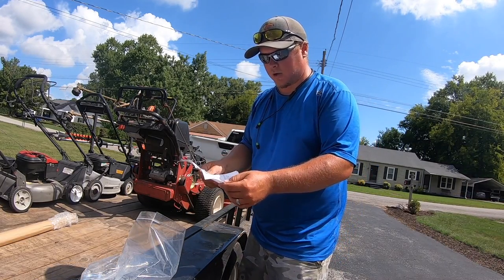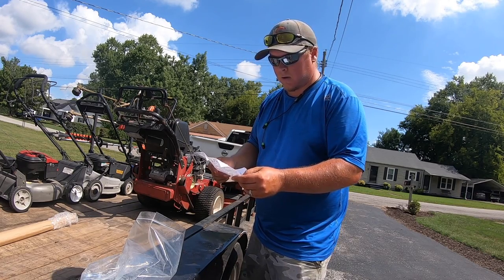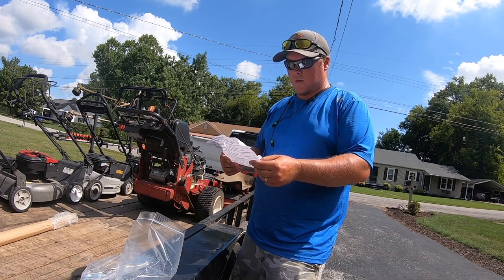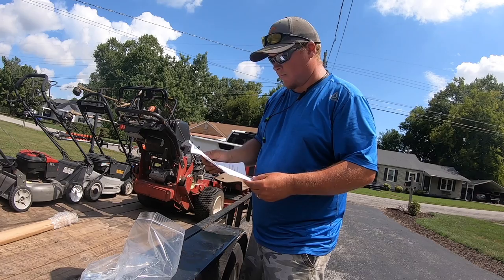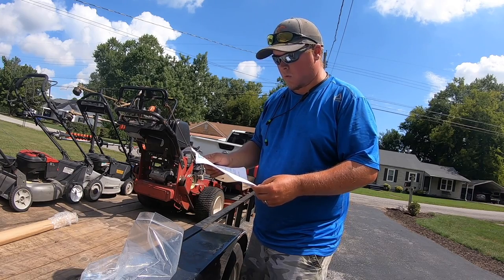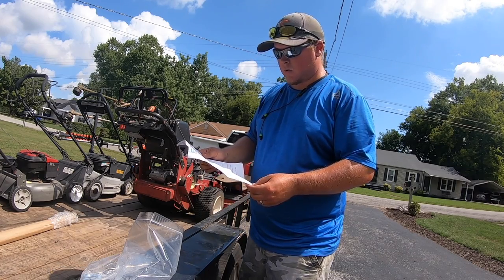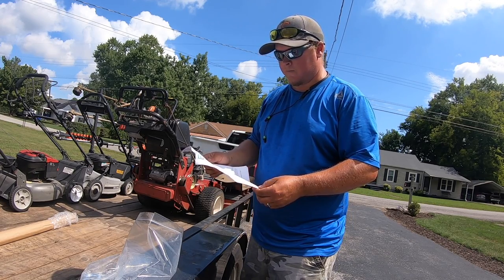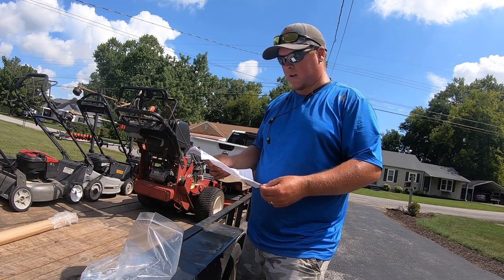Guys, we're going to go ahead and read these instructions. It says, thank you. Your satisfaction with this product means a great deal to us here at Ballard Equipment, blah, blah, blah. Caution, inspect parts, blah, blah, blah. The easy gate can be mounted in approximately 40 minutes with 10 easy steps. Caution, inspect parts and compare it to the list provided. Remember, the eye bolts have tension and could spring back and cause injury. To avoid injury, make sure the open end of the eye bolts face away from tension. It's not recommended to increase the tension for what you may believe it will be lifting the gate by drilling different holes in step number 9. However, for heavier gates, it may be necessary to drill at 1 inch or 2 inches higher on the gate.